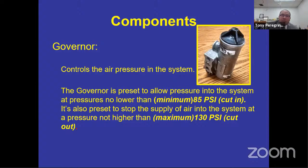And when it's born with a number, it's going to be born with a cutout number, and it's going to be born with a cut in number. I can almost guarantee you that every single one of your buses is going to have an air governor cut in above or at 100 PSI. Why? Because all of the moving parts need to have at least 100 pounds of pressure to ensure that they all move the way that they were designed to move or activate. So the air governor cut in is probably going to be somewhere at 100 or above. The newer the bus, the higher over 100 it is. At least that's what I've seen,